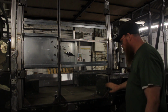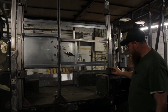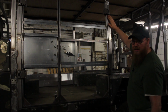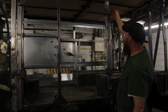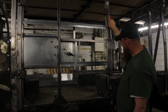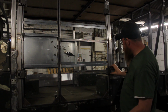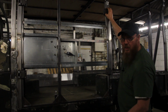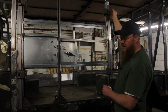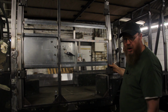So the same thing, made the frames, and then, like I say, modified the hinges, because this is vertical and then it tumbles home here. And so obviously the angle face against the pivots on the hinge pins needed sorting out. So like I say, I got a piece of box, clamped them together where I wanted them, put them on and measured the distance, the gap, because they've already got a machine face, angle face on them for the Land Rover frames that they go onto.